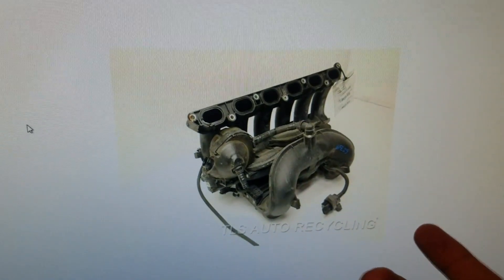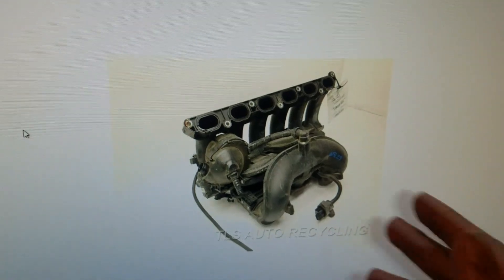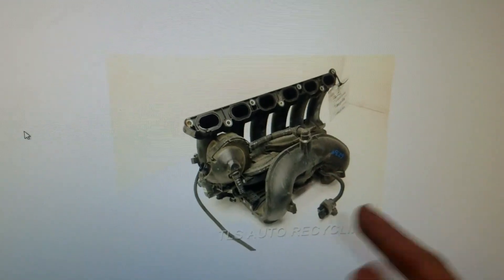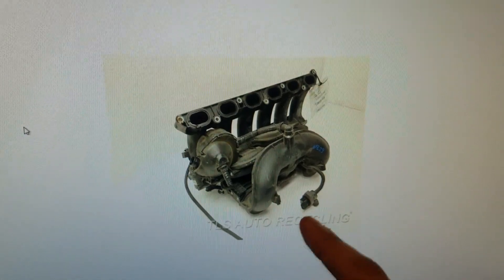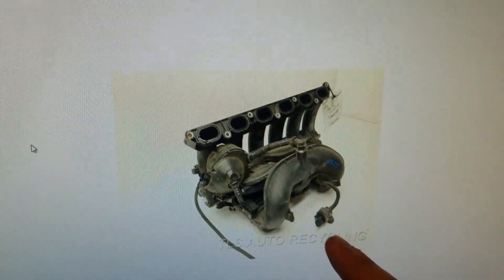It's better to get a manifold that fits your car, but sometimes — especially if you have an early-motor car with a single-port hose — you don't have as much choice, because there aren't as many of those cars and a lot of them are higher mileage and older now, so the diverter valves are going to be beat up.